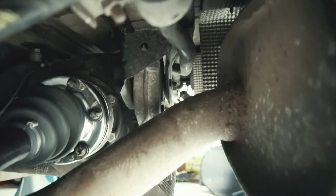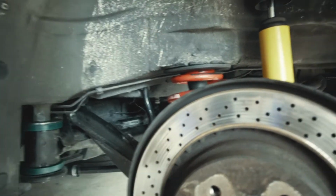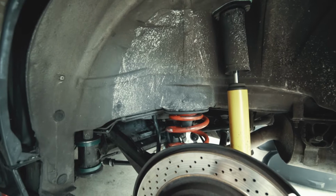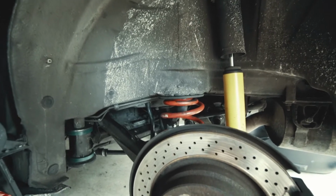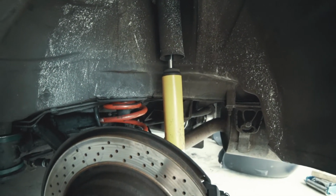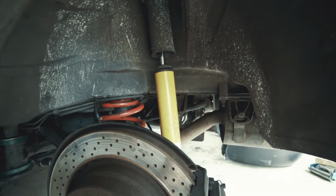I left the differential mount bushing alone because I think it was changed out a few years back when somebody hit the car. When I looked at the bushing itself, it looked pretty good. I hear that polyurethane differential bushings are not good for the car. They tend to tear at the subframe and start to separate. So I decided to stick with the OEM ones.